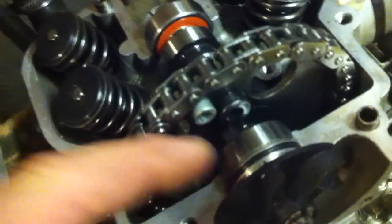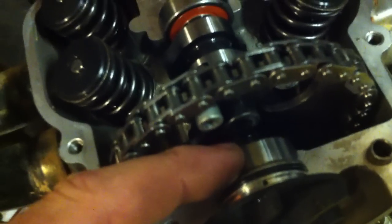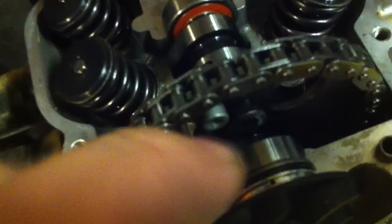And on the front, even with taking this impeller off for the water pump and the aluminium housing that is in between, the other bearing sits on the inside there and that will not allow you to rotate it either. You can't lift it enough to turn it.